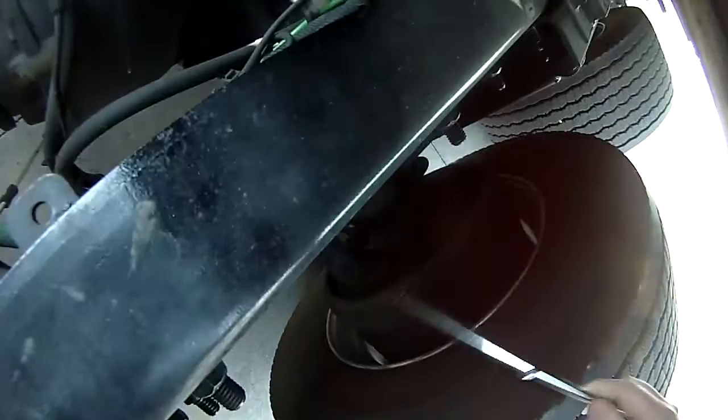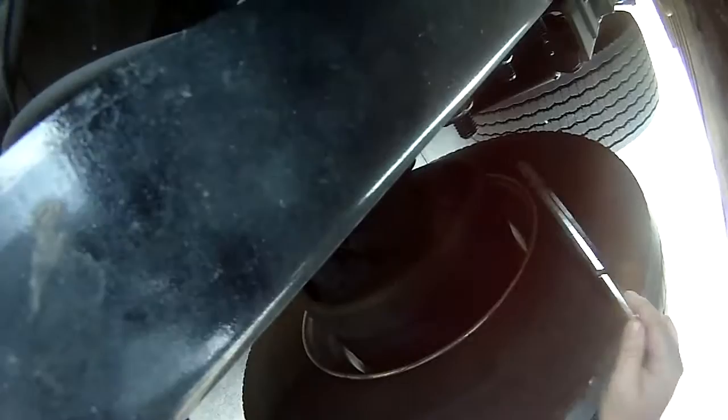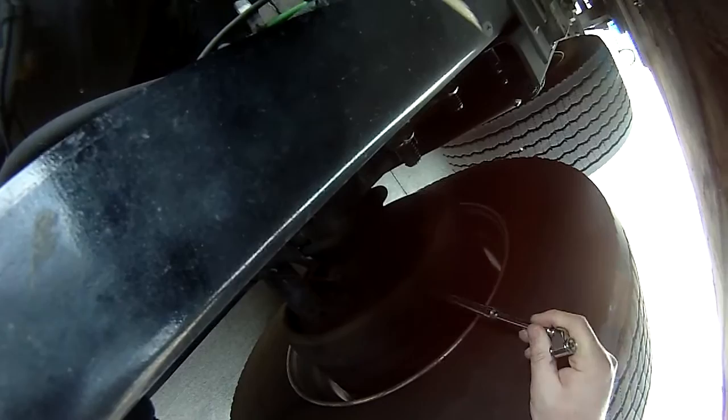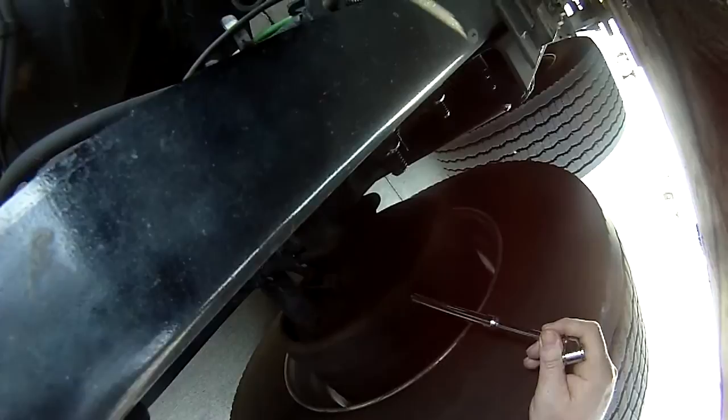And we go to our brake drum. Properly mounted, secured, not cracked, bent, or broken. To our brake lining, inner part right here. It's up against the brake drum. Properly mounted, secured, not cracked, bent, or broken. Free of any oil or grease or debris, and the friction material is not worn dangerously thin. Then we come out for our tire.